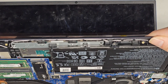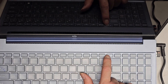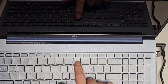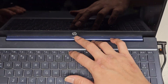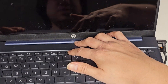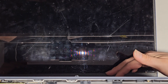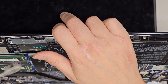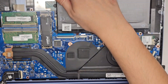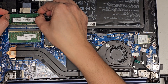I'm going to press and hold the power button to power it off completely, make sure the power light goes off. Let's power it on again, press F9 — the fan is spinning. Maybe there really is some other weird issue. I'm going to force power it off again and pull the SSD out. It could also be the RAM doing something weird. I'm going to brush off some dusty stuff I see here, pop the RAM out and pop it back in, because sometimes RAM issues can cause it to not start up properly.